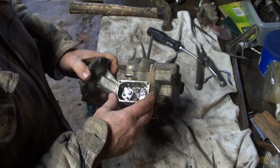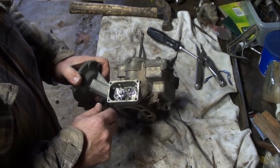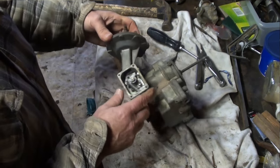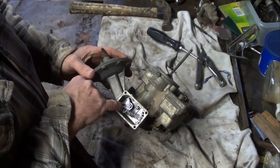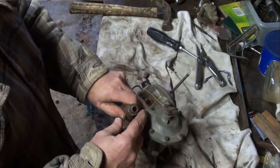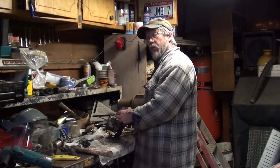Well, this one is far simpler than the other design they had. You can change the tension on the spring here — I'm moving it to a different location. I don't know what this thing is, or why it has a zerk in the end of it. It's probably just to plug the hole. There's a place where a piece of linkage rod is supposed to go in there, so there's got to be a diaphragm on here with a linkage rod on it — and that would have been a vacuum line. The vacuum passage is probably right here. So basically what will happen is this governor will not work.